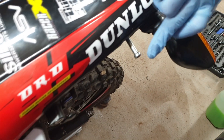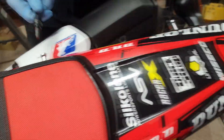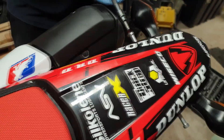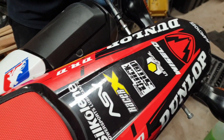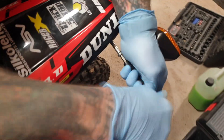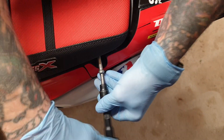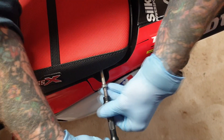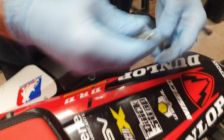Okay, these are the mounting bolts in question. You've got one, two — same as the opposite side — three, four. So first off we'll crack them using a number six, I think it's a 6mm Allen key. Just crack them, we'll whip those out and then we'll start to roughly align the spacers, bolts, and rack in situ.